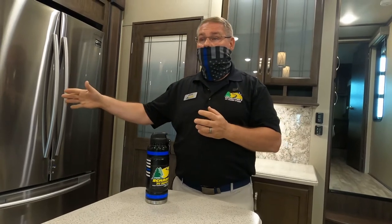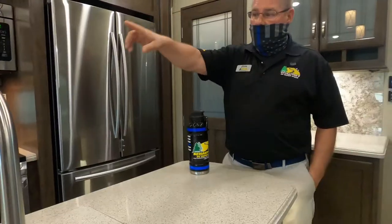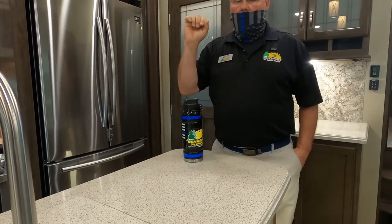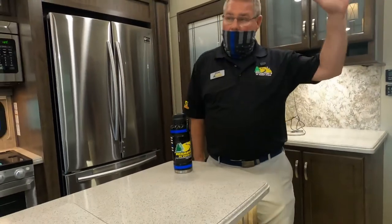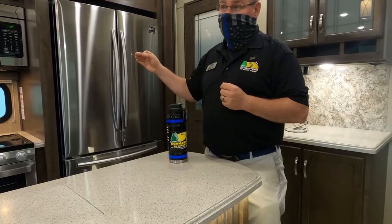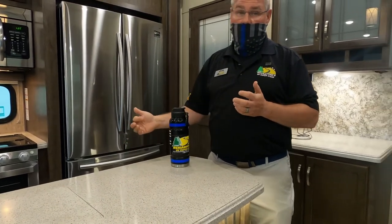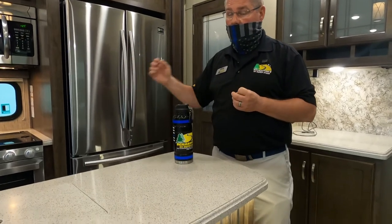So whenever you're operating, whether you're bringing them in or letting them out, please make sure that you have a spotter on the outside. You have a nice big window there. You have cell phones, whatever. However you need to communicate, you want to have a spotter on the outside. The reason being is that you are going to park as close as you can get to your neighbor's campsite so that you can maximize your camping space, all right? If you are 2 inches too close to a low limb you just didn't see, to a stump, to a tree, to the pedestal where you're getting your water, your electric, and your cable, 2 inches too close and you're going to be damaging your camper. Don't want to see that happen.